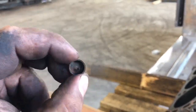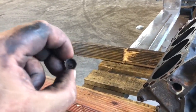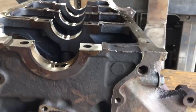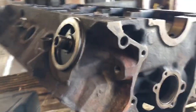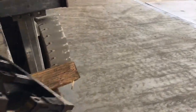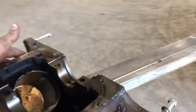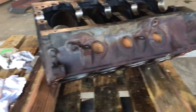This is the plug that came out of the front. See where I kind of smacked it with a piece of filler rod? You could use a dent puller to snatch those out but I don't have one. The dowel pins are out now, we got all these little plugs out. I got the cylinder head dowel pins out. These guys right here do not want to come out at all. There's another one over here, so I'm going to go home and get some better tools and try again.